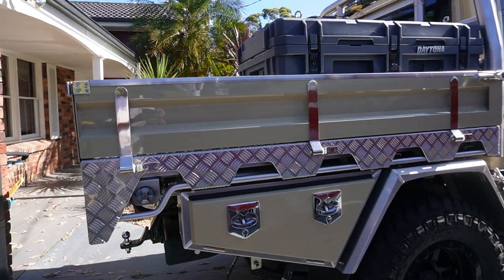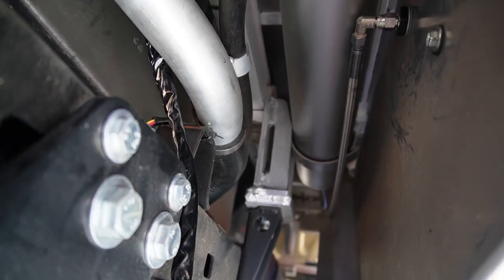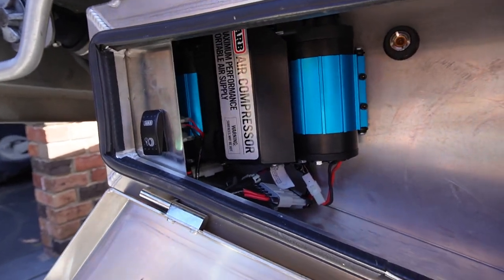That went on pretty easy, and it's good to know it'll come off easy too. The fitment behind the toolbox is very tight — the tank really doesn't have much clearance at all — but I got the measurements right and it's looking great. Time to wire this thing up. I haven't run cable down the length of the 79 before, so I'm planning to follow the trailer plug loom to the engine bay. I won't be showing this part in detail — it's pretty straightforward — two cables to the battery with a 100-amp circuit breaker on the positive side in the engine bay.